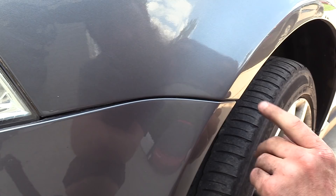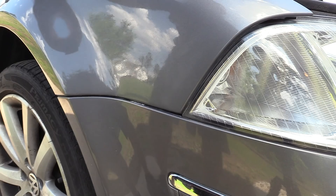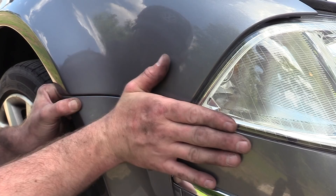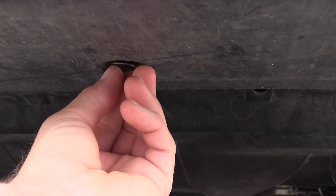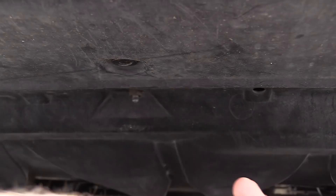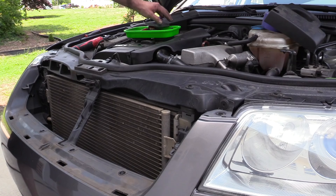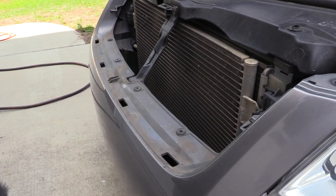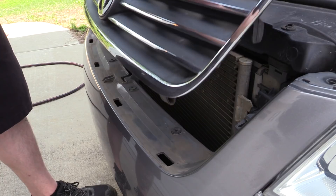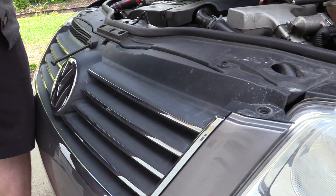This side looks pretty good too, so we just need to slide the bumper cover back a little bit and that'll get it lined up right. I have had cases where you really have to crank down on it to get the bumper cover back on correctly — those are usually cases where someone has wrecked their car. Next, put the fasteners back in at the bottom of the bumper — one on the left, one on the right, and one in the middle. Then put the four bolts across the front of the bumper. Now go ahead and put the grille back on. The best way is to slowly lower it into the bumper cover the way it's going to sit, push it back a little to get the bottom and side alignment tabs, then snap it into place and put the last T30s in.